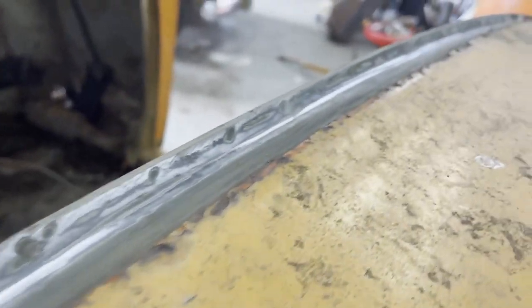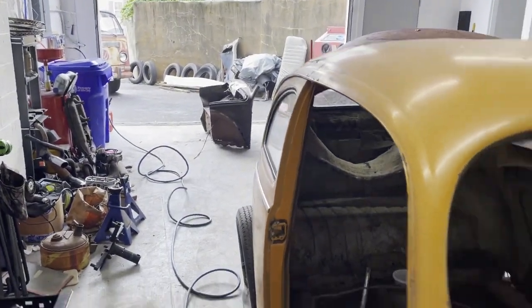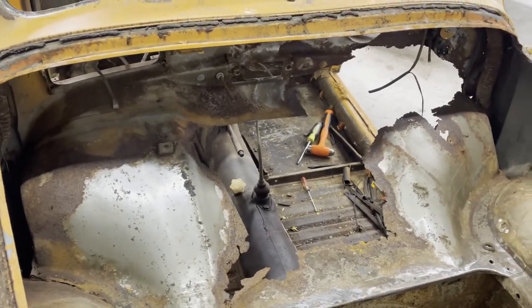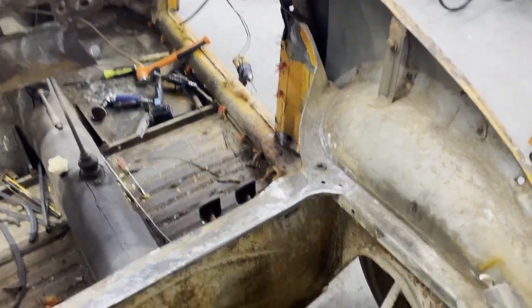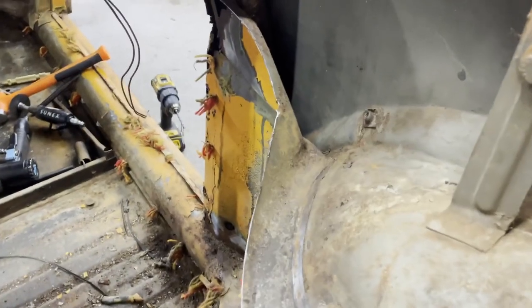Clearing started. Let's get in the paint bag looking for spot welds. I'm gonna start cutting some of the dead metal out of here just so I have a little bit more room to work, and start exposing all of that over there so I can figure out what space I have to work with. This is like the practice cut so that I know what to expect when I start cutting that one. I'm gonna cut a little bit more from over here and some from this side just to get under the dash and start cleaning that up to find the spot welds I need to break. I don't really know what I'm doing.